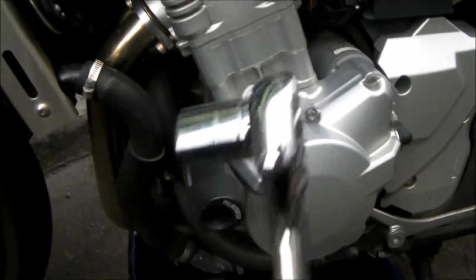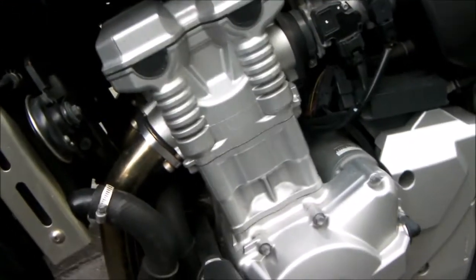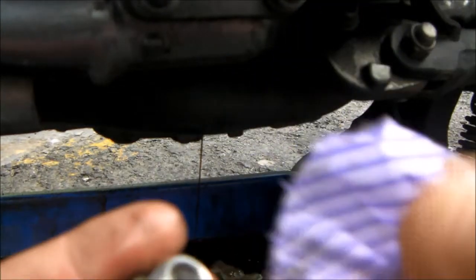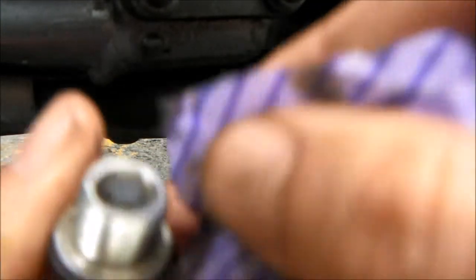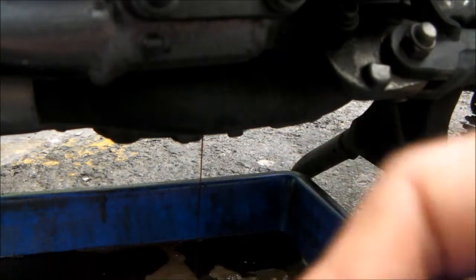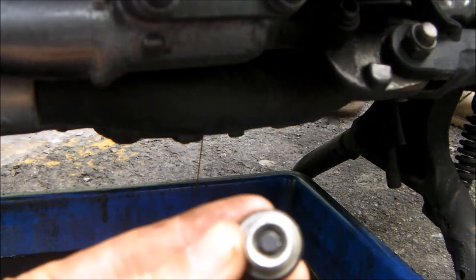So, right. That's a 17mm bit. Where's it? 17mm bit, 17mm ratchet. First thing you want to do, warm the engine up. Second thing you want to do is get under there, get your cat litter tray under there, and crack that off. So just clean that off, clean off any swarf before you put that bolt back on. Yeah. Not perfect, but much better.